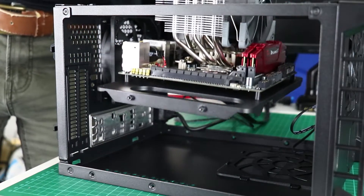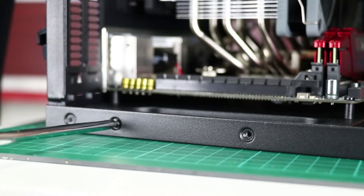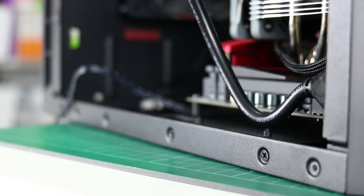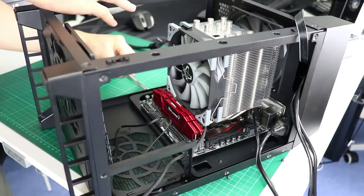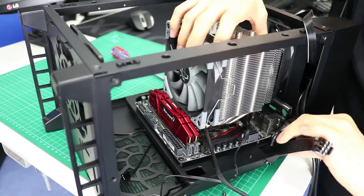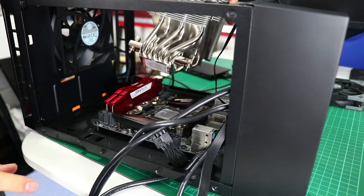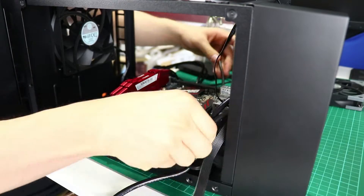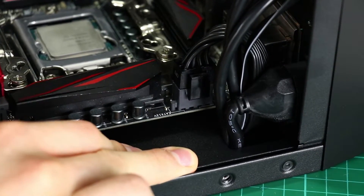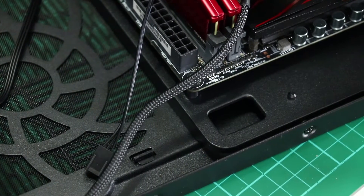Dropping the motherboard tray into position is one of the most challenging parts of this build. To get the best-looking results, you'll want to detach the tray from the case and route the PSU, USB, audio, CPU, and fan cables through the cable management holes around the VRM. I felt I had to remove the cooler to make all this work, since I was constantly nudging it. All the cables will run through the larger hole in the tray since all the cables worth cable managing are right next to it — the smaller hole I didn't use at all.